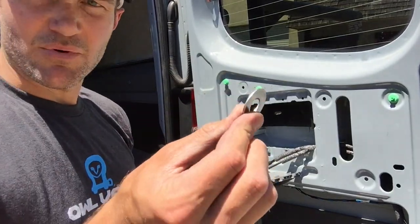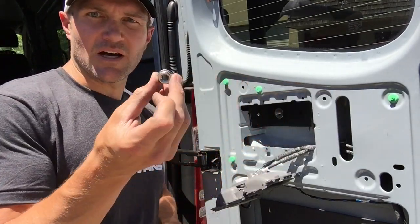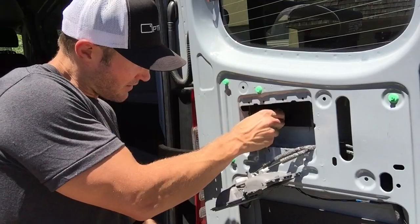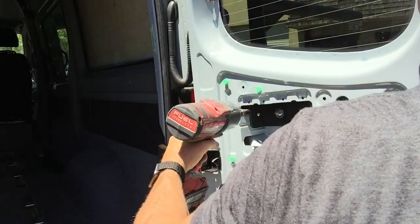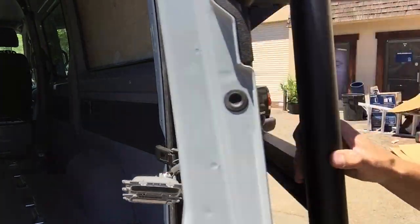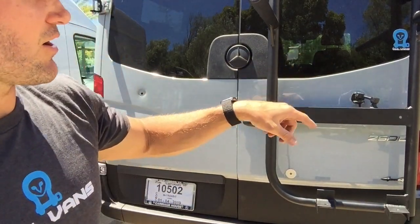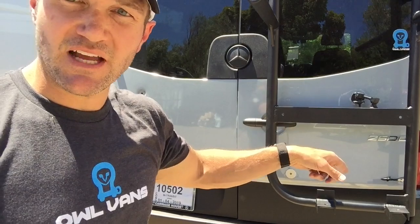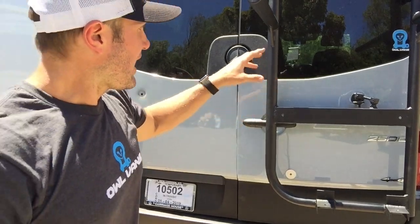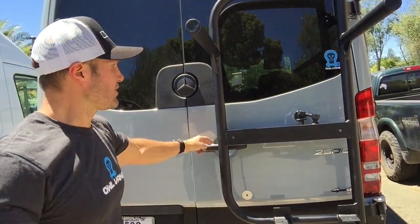Inside the door with your sway link, put the washer and then the nut — yours should be a stainless steel nylock nut. Now you've got your bike rack with both bolts and everything tightened down. Go back and snug all of the hinge bolts — make them quite tight, as tight as you can. Make sure the main large upright bolts are tight. Everything should be good to go — you're ready to mount your box and your one-up racks to those tubes, and everything should open with the door. Thanks everybody.